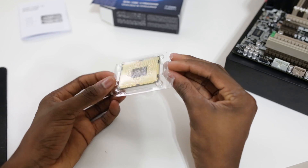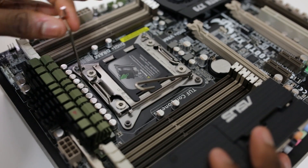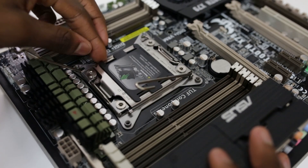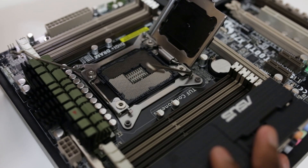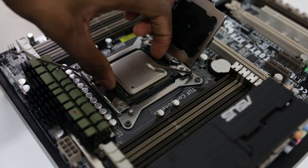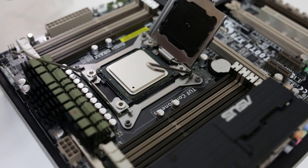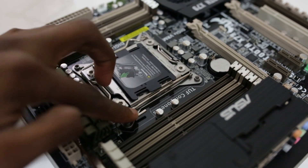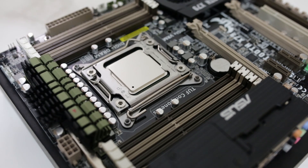It's really fun to admire these parts. Installing the CPU onto the motherboard is one of the more fun parts. You don't have to touch the top or bottom of the CPU — you just want to lay it to rest right on top of the pins without applying any pressure, then close it up, and that's it. CPU installed. You might feel like you're putting a ton of pressure on the clamps and feel like you're going to snap them, but that's normal. Once you close them, these are tough clamps, tough board, tough stuff.